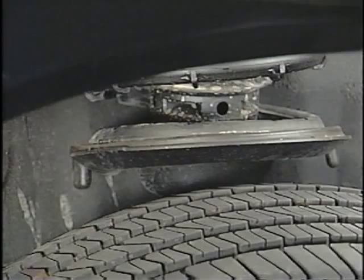Now, back to squeaks and rattles. Some Regal and Century owners may report a squeak noise coming from the rear strut when it hits a bump, particularly in wet conditions. The squawk is produced by the spring rubbing against the funnel-shaped rubber skirt on the strut assembly. It would actually make a squawking sound, especially when it's wet.